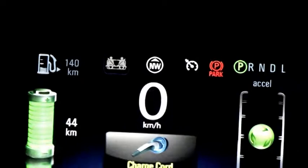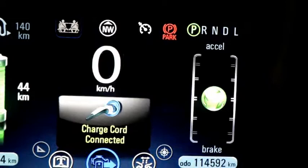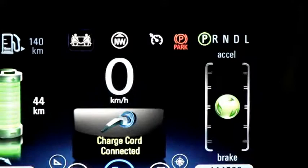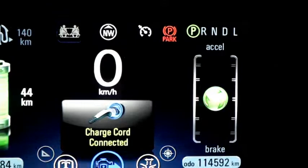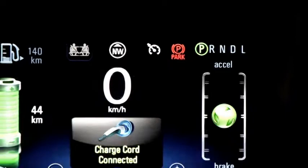We can see our direction — currently pointing northwest — and our cruise controls. On the right-hand side you'll see a range indicator that goes from brake to accelerator with a little circle. That circle moves up or down based on how fast you're accelerating or how much you're braking. GM built this in because the ideal is to keep that circle as close to center as possible — that's driving super efficiently. If it dips too much to brake you're using more physical braking than regen and losing regen energy, and if it goes to accelerate you're using electricity faster.